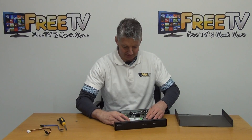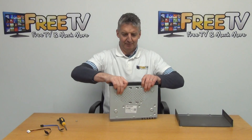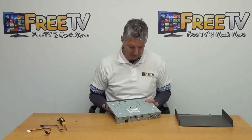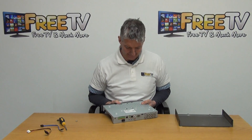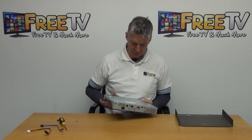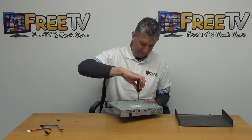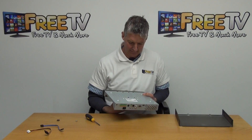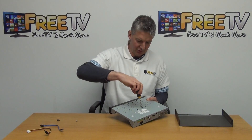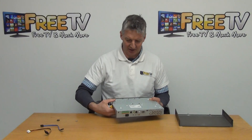What I can do here is just try to slide this down a little bit and rotate it over the DVR itself. We can just line it up perfectly here. I'm going to loosen off this screw marginally, and it just slides in there like that. With my screwdriver, I can just lock this into position. Now we have the actual hard drive attached onto the chassis.